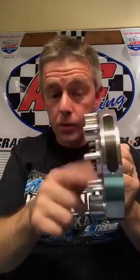Sorry, David. But the different fan design on a 6689 is going to give you less air drag on top end. I covered this in one of my other videos, but you take a 6619, you get it set up to your AKRA engine, you get it tuned on a dyno the best it can do. You take tape and put it on the blower housing so that less air can get in. What happens to your numbers? The numbers go up because there's not as much air going across the flywheel, therefore these boat paddles are not in the water. You take a boat paddle, put it sideways, try to pull it, you feel resistance. You turn the boat paddle sideways, it zips right through the water. Same thing with fin designs.